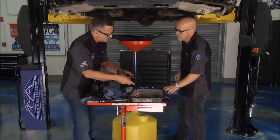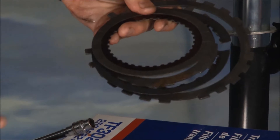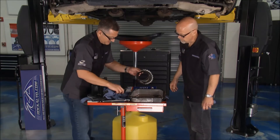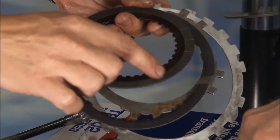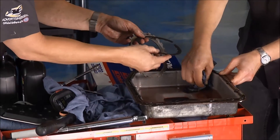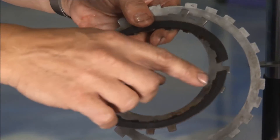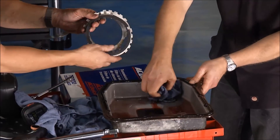Check this out — I got some old clutches and some new clutches. This is how a transmission actually works: it uses line pressure and squeezes these between metal plates. That's what you just scraped up — a bunch of material from these fibers. This is a brand new one — you can almost see the lines on here, and it's going to wick away a lot of that fiber material. That's why it's so important to change the fluid. Now take a look at this old one — it's mostly missing. It must be on the magnet. It's also broken. So that fiber is going to wear out over time. Good idea to change that transmission fluid just for that reason alone.